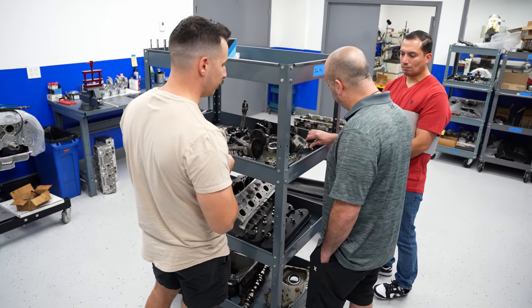Once it starts wiping that bearing, it doesn't stop. You ain't fixing it with better oil — you ain't putting Slick 50 in it. I have a bunch of Corvette guys that got mad at me for going 50 weight, but I was just trying to keep it alive, just to bandage it a little bit. But Chevy specifically says when you're on road course, go up to a 50 weight. It's because of oil temp — on a road race you're in and out of the throttle, wide open, so oil temps go through the moon. A multi-viscosity starting at 10W-30 is going to be like water by the time you're done, and oil pressure will go down with oil temp.